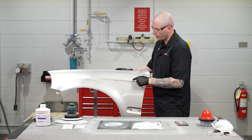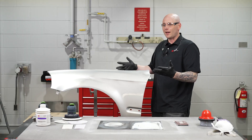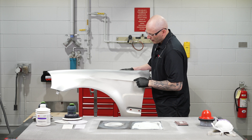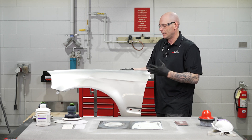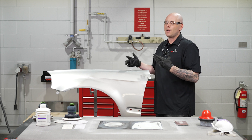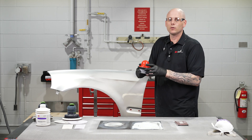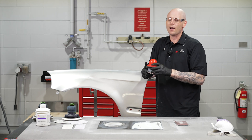As you can see, our straight line scratches really stand out now that we've DA'd the area with our finer grade abrasive. Again, think about a really technical color with a really finely ground metallic — if we didn't use guide coat, we wouldn't know those scratches are still there. If we didn't fill them by doing a wet bed or something like that, the metallics would definitely fall into those sand scratches and show up in the final result, definitely causing a repaint. So that's just one more reason to use guide coat, and one more place we can use it — it's not just for the body side. I'll always recommend guide coat for the paint side as well. Thank you for watching this video. Hopefully you learned a few tricks around dry guide coat. Be sure to like, comment, and subscribe if you want more content like this. Check us out online at 3M Collision Repair Academy — the link is in the description below. Thanks, and we'll see you next time.